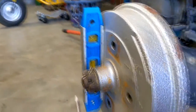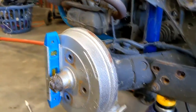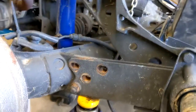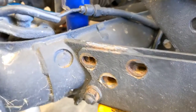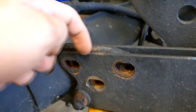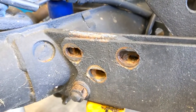That's what I ended up doing on the other side. Now after you get everything aligned and straight, you'll see your bolt holes don't line up, so that's not going to do you any good. What I did on the other side — and a lot of people will say don't do this — I kept it cold, did some short beads, and actually threw a tack weld on each side, a little more than a tack weld.